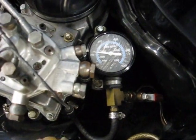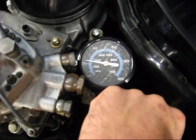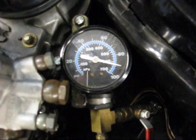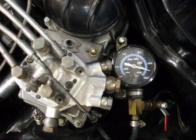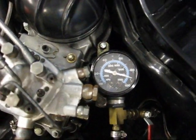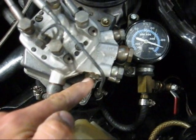The next thing you want to do to measure system pressure is close the valve after your gauge. Now you can see my system pressure is set at 90 psi — obviously that's about 15 psi higher than what you would run on a stock 320i. I've used shims on my pressure regulator, which is right here, to bump system pressure up.